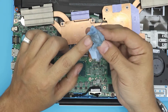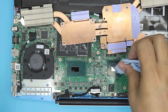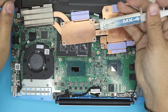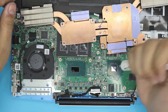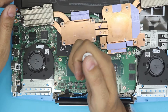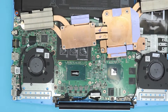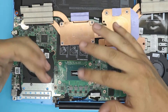Now we're going to clean the heatsink. Grab a shop towel and some alcohol. With the CPU there are no capacitors on top, but with the GPU there are tiny capacitors, so be careful and gentle — make sure you have pressure on the die but don't press too hard on the capacitors. Let's do a second pass — make sure the mesh is nice and clean. You can see all this dirt; these are oxidation from the copper. Keep rubbing for a few seconds to remove all the dirt so it should be really nice and shiny.